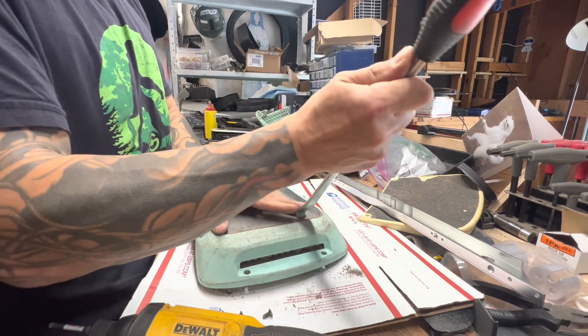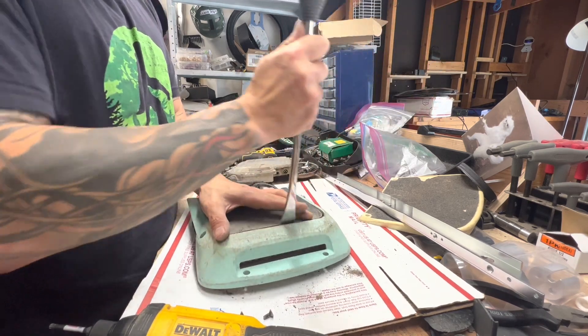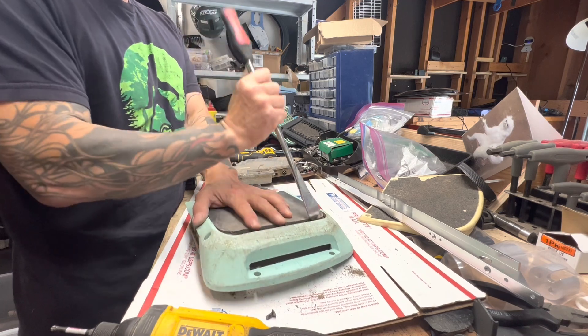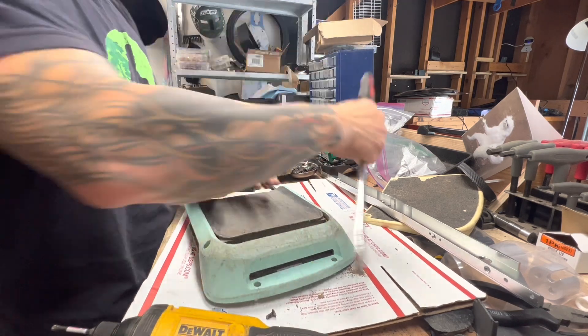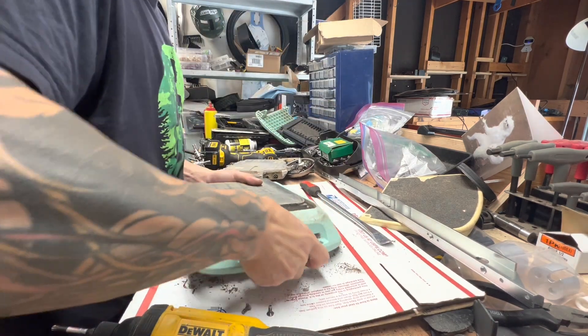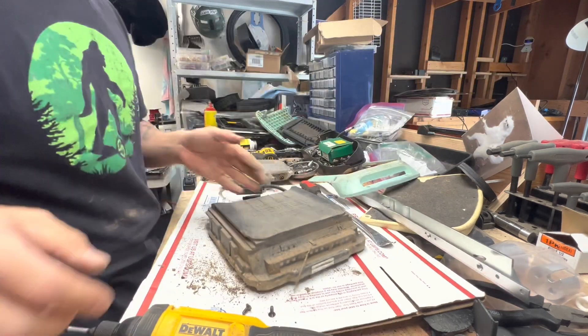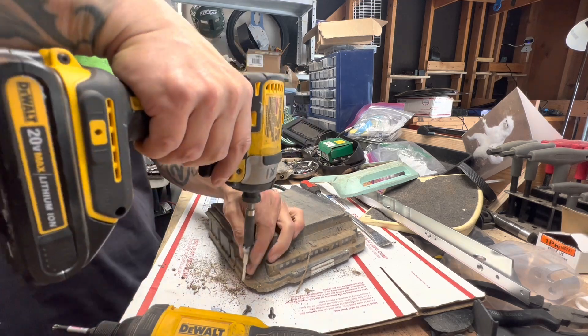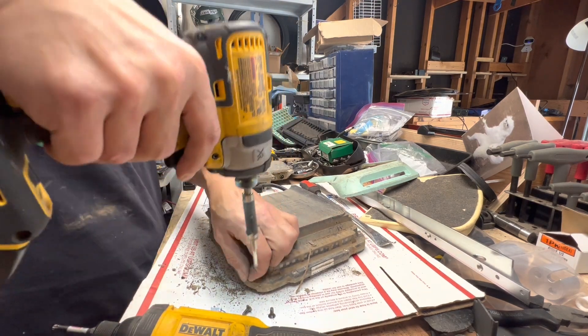You want to take a tire spoon to the rear bumper on a Pint X because sometimes they can feel like they're glued in there, and you need to get underneath there to get to the battery lid screws. So take just a tire spoon or a screwdriver, wedge it in the back, and work it out so that you can get that bumper out without having to fight against all the dirt and debris that gets stuck in there.